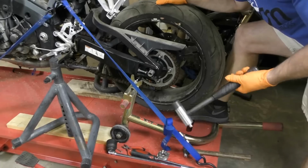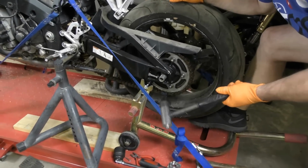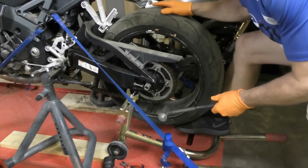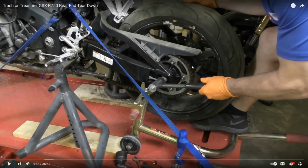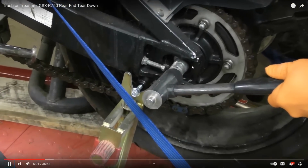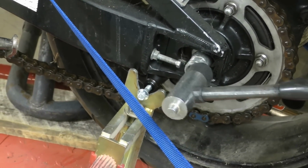It's dry. So the next piece is a little bit of gentle encouragement. You can use a sand hammer or a dead blow hammer. I'm going to use a hard rubber hammer and just try and tap it and see if it'll break free. Some people call them glass hammers. If it won't break free, we have a much bigger problem to try and solve.